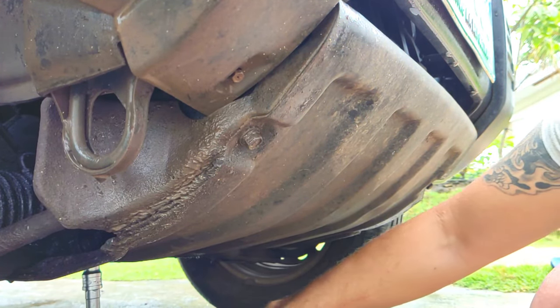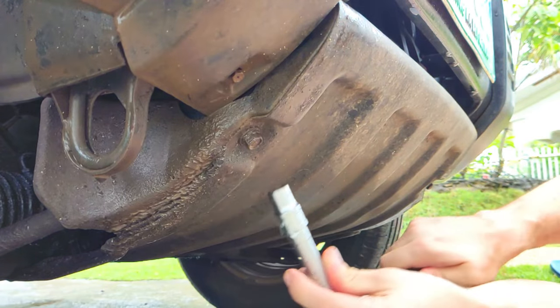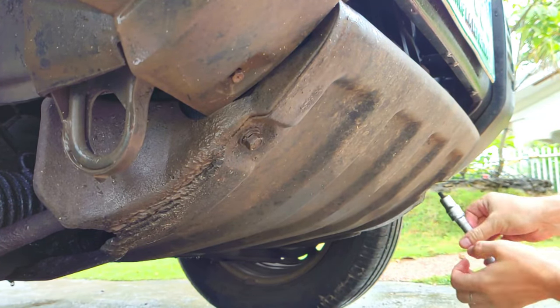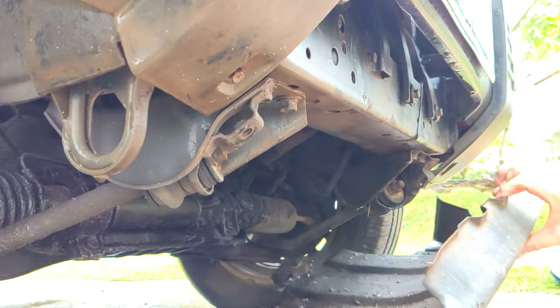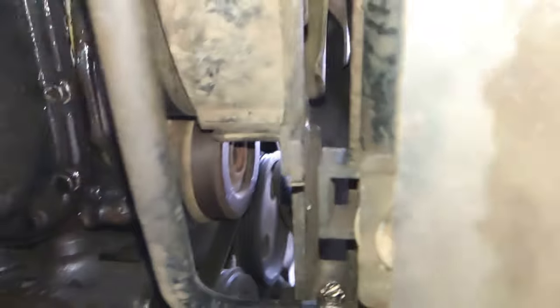Well, this is not as bad as on the big Pajero — it's got four 12 millimeter bolts. On the big one you've got like seven, then you've got two different pans that you have to mate together when you put them on and take them off, so it's a little more tricky. This is pretty easy. That was pretty painless actually. I can easily get to the automatic transmission line there, and I saw another one up here, and then the hose there. So this should be out pretty quick I think.